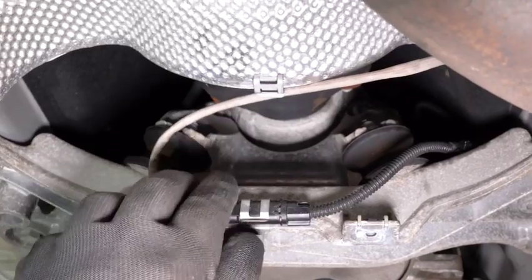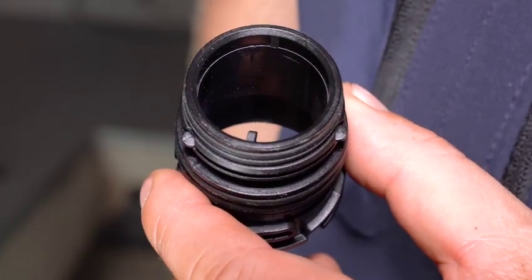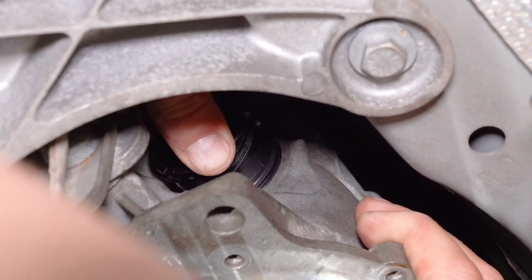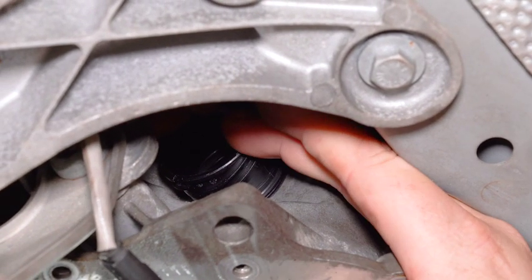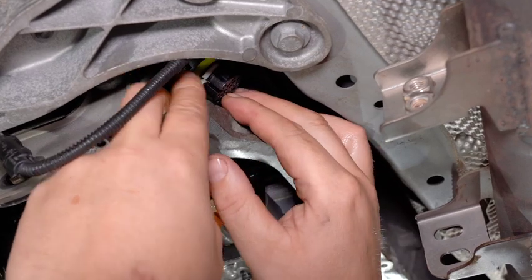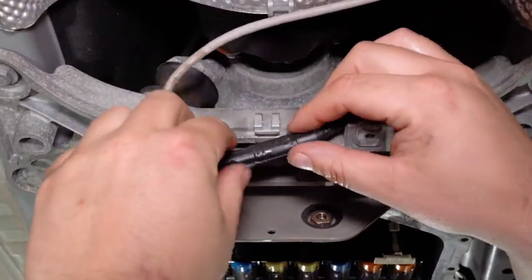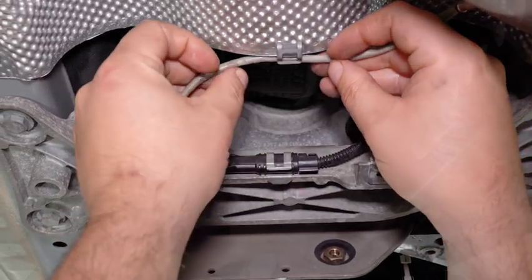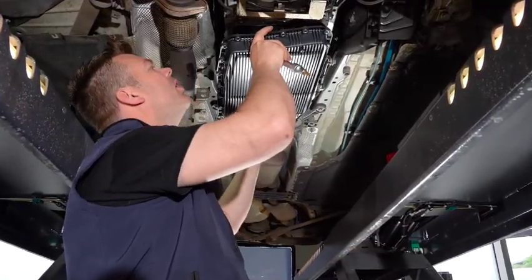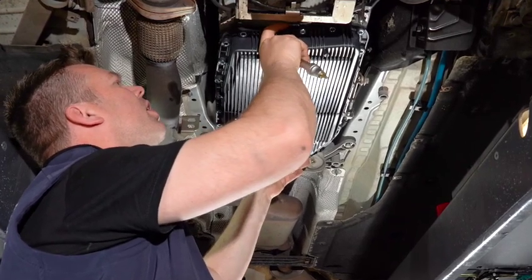Now we just undo the wire as well as the socket. This small tab must be installed facing downward just past the 6 o'clock position. While you're pushing it in, try to turn it and it will get into the right direction. There we go — just put it in, lock the sleeve with it, then put the socket on and lock it. You will hear an audible click noise. Now we just reinstall the wiring.